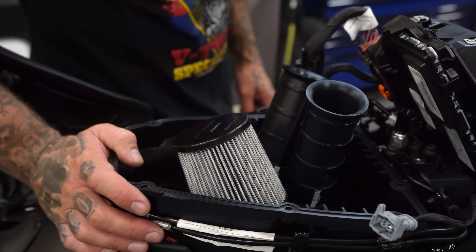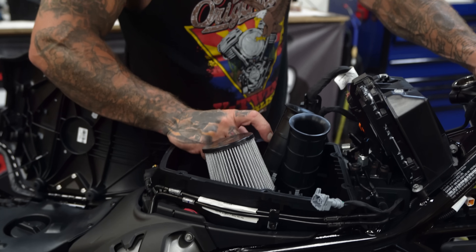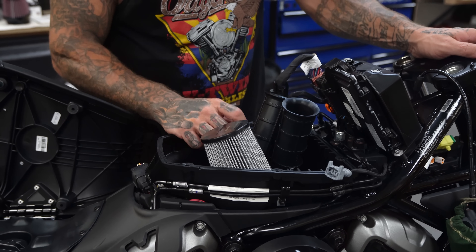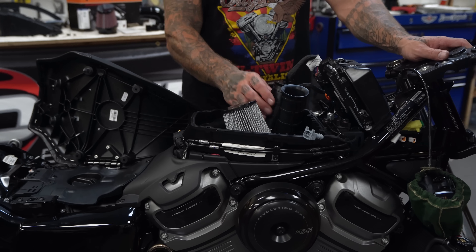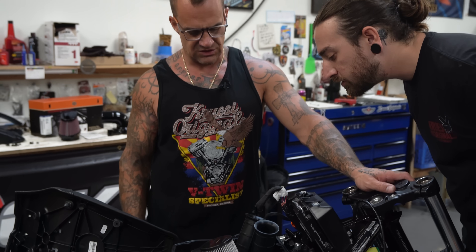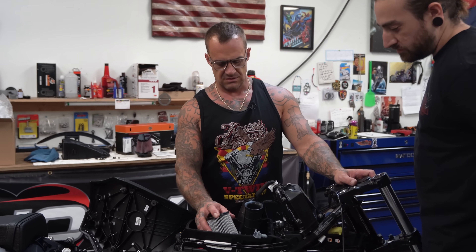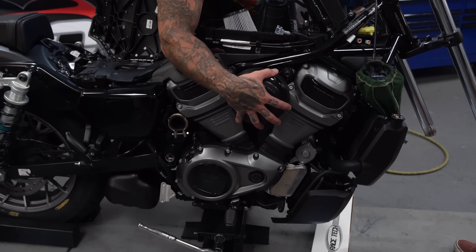That's definitely not what I expected. It basically has an intake on it already. These are the velocity stacks that we need to change out. Hey Trent, can you look up the velocity stacks for a Panamerica for me? I'd like to see what they look like in comparison to this. Look at this weird setup — a lot of tubes. Are these the velocity stacks we're talking about that you need to change out to make more power? Because that's the butterfly right down there. This also has a butterfly in there. Dual throttle bodies. Then the filter, then that tube goes to the side. So you'd get rid of this filter and it just sucks down there. It's still a good system already, except this is choking it up — it goes right to the back of that cover.